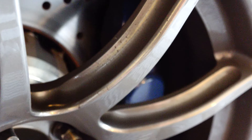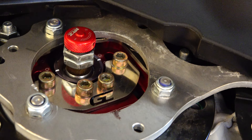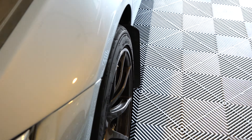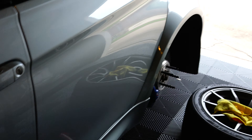I did remove the brake pad sensors. Since I look at my brake pads all the time when I swap my wheels, I really don't need the warning going off, so it's just tied off and not used. Ground Control camber plates are in the race position — my camber is pretty aggressive at about minus three and a half to minus four. Right now I have 275s in the front, but on the track I run 295 square. You can see how the tire sticks out about 10mm more with the 295s, which is why I have the gigantic mud flap in the front to protect the wheel arches.